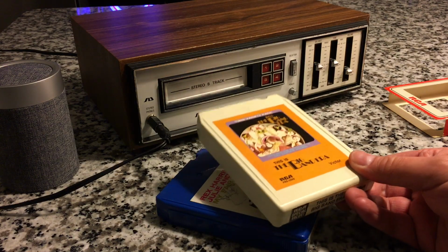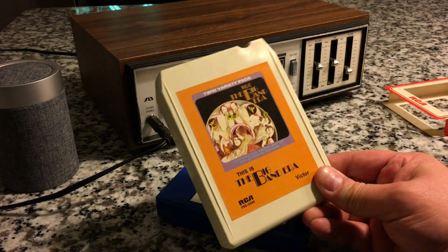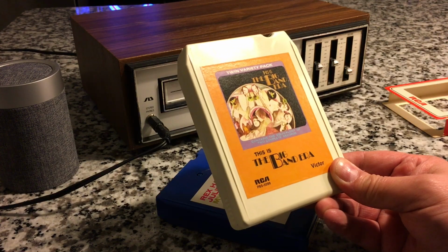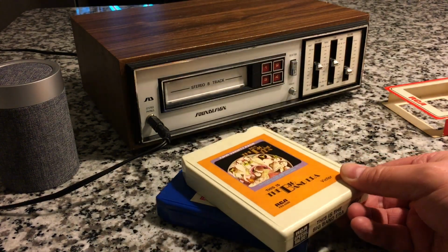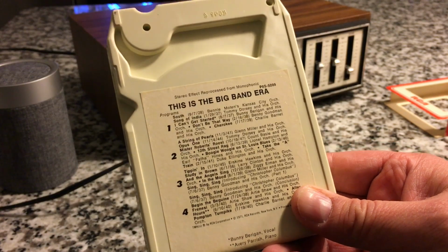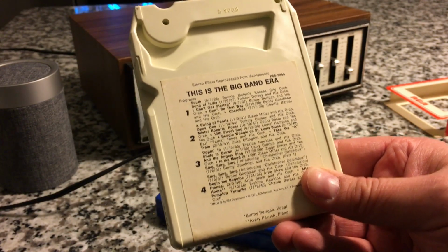And one of the guys working for Bill Lear was a guy by the name of Richard Krause. So Richard Krause is actually the one that invented this format, designed it based on all the input from the group. And it made some improvements. So it doubled the number of tracks. So you may be saying, 8 tracks, what does that mean? So basically, it's got 4 programs. Well, those programs are stereo. So stereo requires 2 tracks. So 4 times 2 is 8.